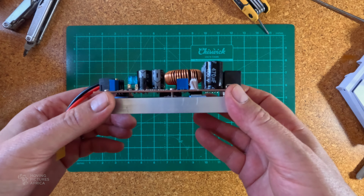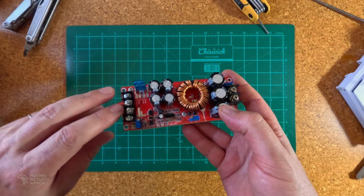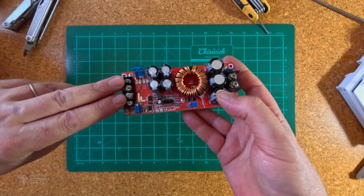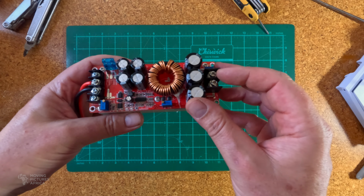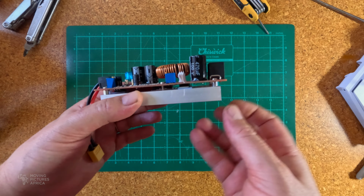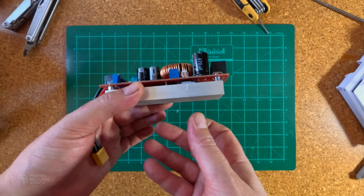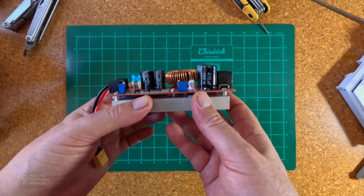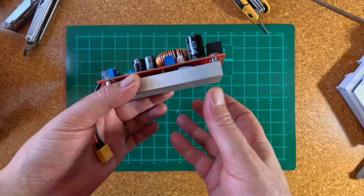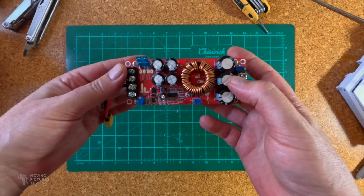So I ordered this 1200 watt boost converter off Amazon. I think it was about $20, and its input can be from 10 to 60 volts and its output from 12 to 83 volts. There's also a slightly chunkier version that's 1500 watts and has a fan. I think I'd rather buy that one actually, because I noticed when running this for extended periods that it does get pretty warm, but I'll put links to both of them down below in the description.